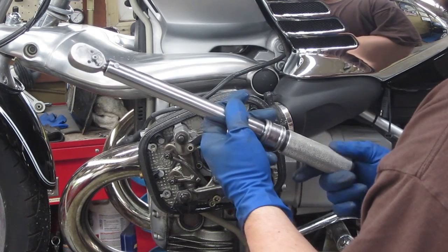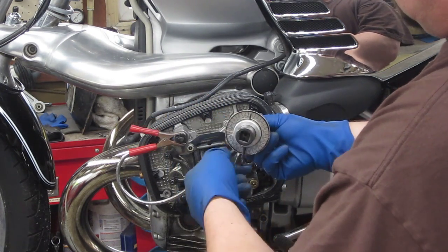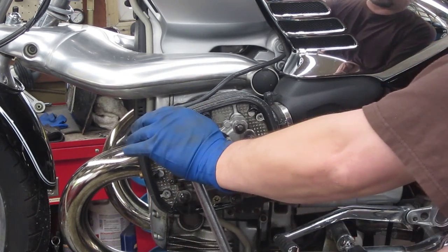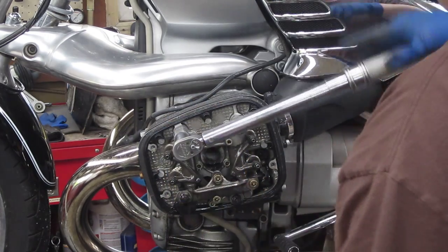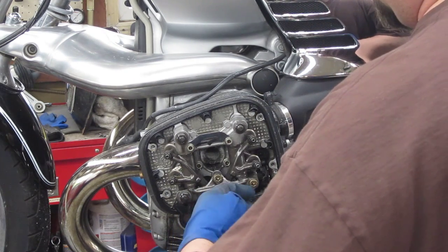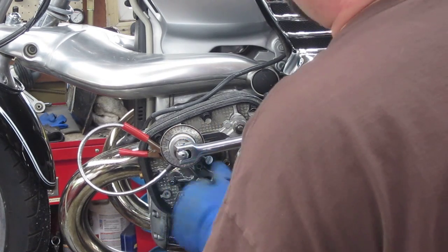We're going to bring our torque wrench back to 20 Nm and get the angle torque wrench. One of these people freaks out — 'What's a jumper cable for?' Nothing but to hold this in place so you can set your dial indicator. Start with your upper left, just like reading a book. Loosen completely. We now torque that one to 20 Nm, grab your angle torque gauge, put it on here, and this is going to get turned to 180 degrees.